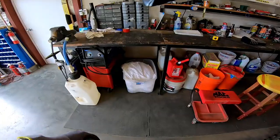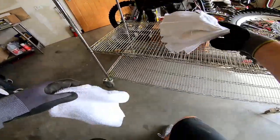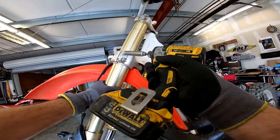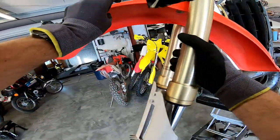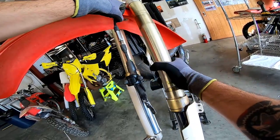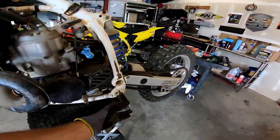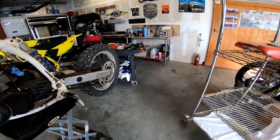We're going to get some little blankets for the forks so they can rest comfortably — don't want to scratch those up. Some forks will come shooting out so always brace them. I've had one fly out on the floor before — more than one, let's be honest. Sometimes when you pull the second fork off while the bike's on the lift stand with all the pressure back here, the bike just flips over backwards. So I need to get the rear wheel off real quick before I pull the other fork.